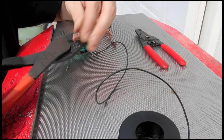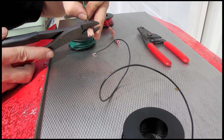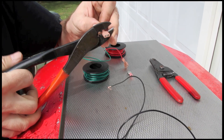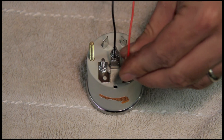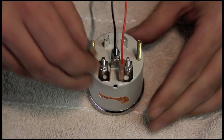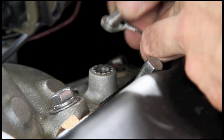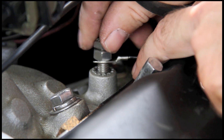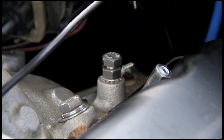I'm partial to the American Muscle series, so that's what we'll be using. We put together the wiring by crimping quarter-inch spade connectors to the ends. There are a number of aftermarket wiring harness manufacturers that also offer one-piece connectors for AutoMeter gauges if you'd prefer to go that route. Now, when running gauge wires, the one place you don't want to take a shortcut is the grounds — I fix more malfunctioning gauges by moving the ground wire than any other single step. Take the extra couple of minutes and ground the gauge directly to the engine.